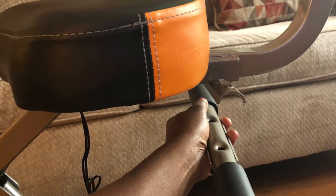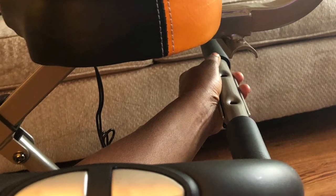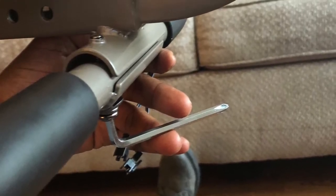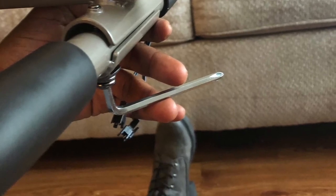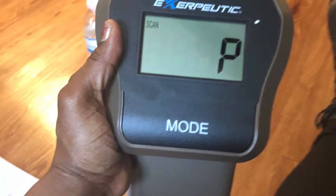The handlebar is very simple. Line up the nuts and bolts and tighten them down with the assigned tools. Don't force them — make sure it's lined up perfectly before you get that Allen wrench in there, because you don't want to strip it and end up with a round hole instead of square, because you will never get it out. This bike is supposed to be transportable and disassemblable if necessary. It also folds and rolls, so be careful and follow those directions to make sure it does what you want.